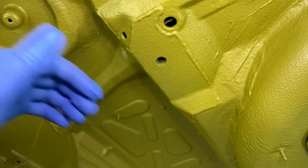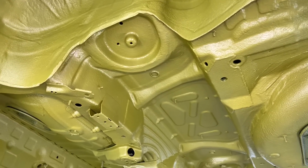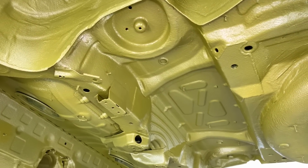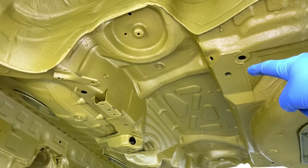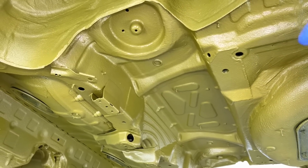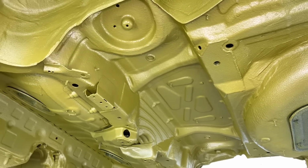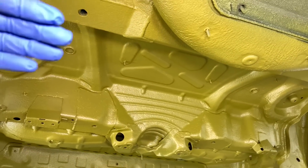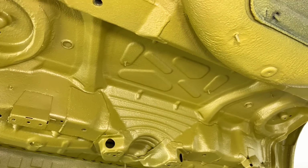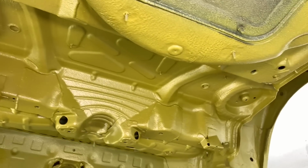That plate just through there is the internal section that you can see from the inside of the boot, where we've cut through the boot floor corner to repair some spot welds and then dropped the 008 plates from the V3 kit down through the boot floor and connected the RACP, the back of it, which is called the cavity cover panel, connected that to the chassis legs, which reinforces that, creates a load relief system and makes sure that it doesn't flex and cause any further problems. So it's attacking it from both sides rather than just underside plates, which years ago were acceptable. Nowadays it's more of a double-edged affair where you go internal, and we've been doing those for quite a few years now as well.